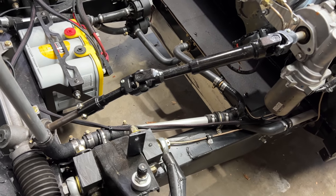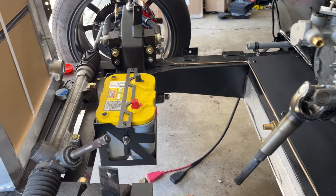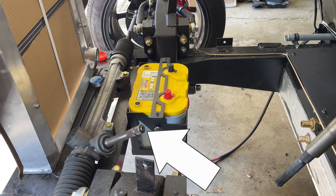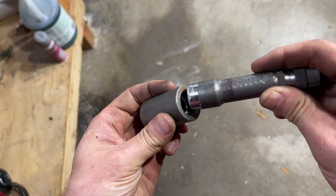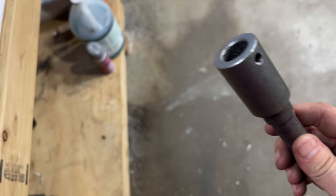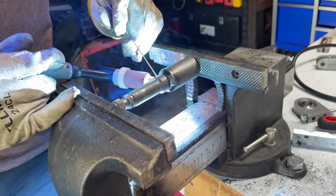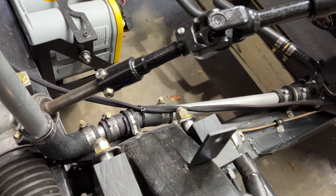I gave them a nice coat of paint to help prevent corrosion. To connect it to the rack, I needed to buy a spline that fit the BMW rack — a 17 millimeter diameter spline with 36 teeth. Weirdly hard to find this part in the US, but there are plenty of 11/16th inch diameter splines with 36 teeth. These are just under half a millimeter too big, but it actually fits pretty snugly. So I bought one of these, welded it on, and added two set screws for extra safety.